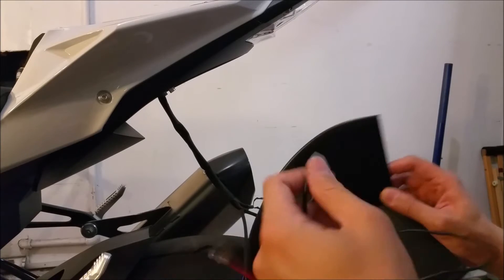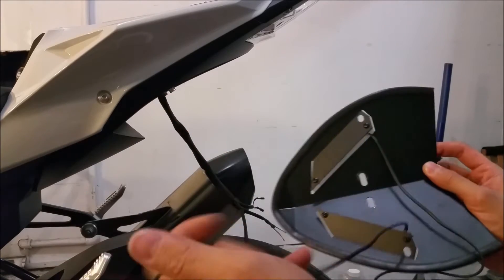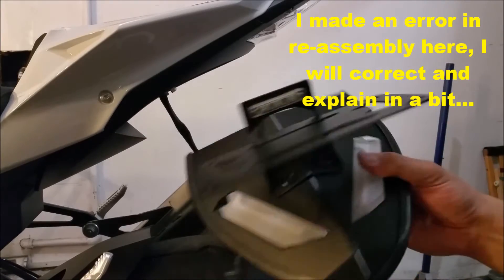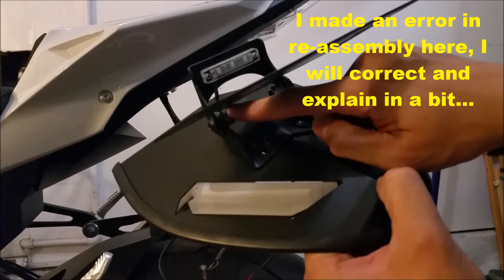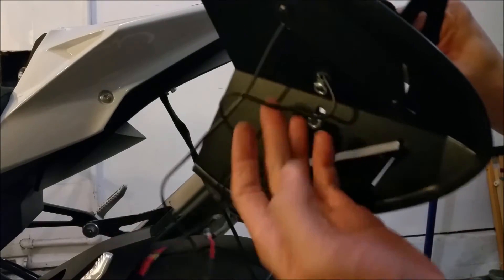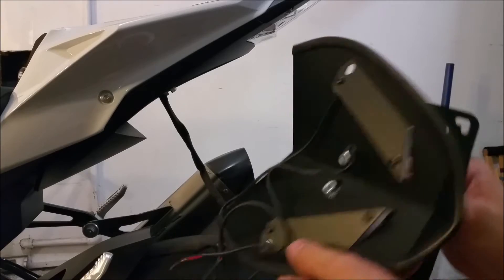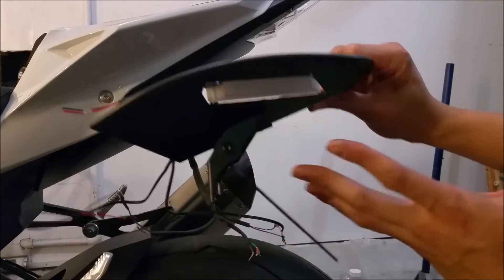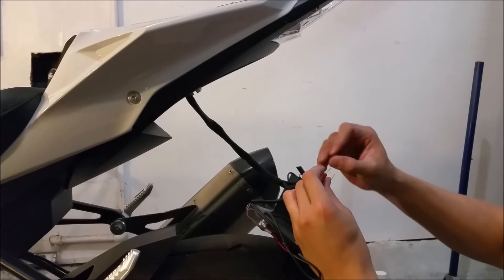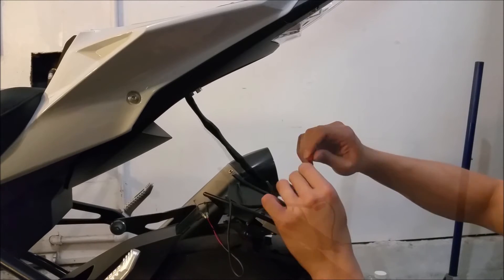Same deal with the front turn signals — it's just contact points, very easy for the turn signals. The difficult part is the license plate light because you have to splice it, but the turn signals are just contact points, same as the front. Here's what I'm working with for the license plate light wire. Try to route them through the space in between the screw here, so they come inside — you're going to tuck all the wires inside and hide them under the undertail. You want your fender eliminator kit to not be showing as many wires as possible. In the kit they included these Positaps, which make it easier to connect the crimped wires. They really provided you with everything you need to get this installed.